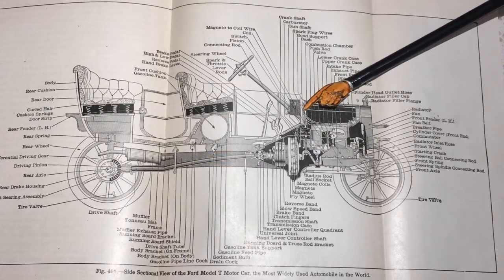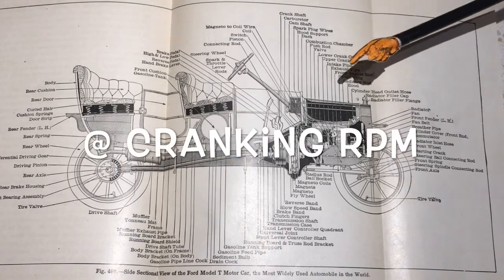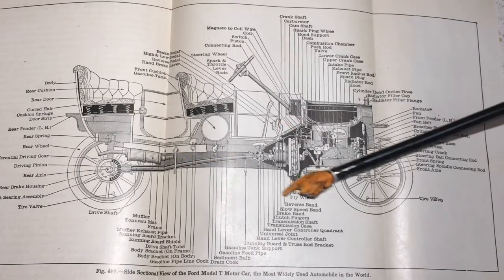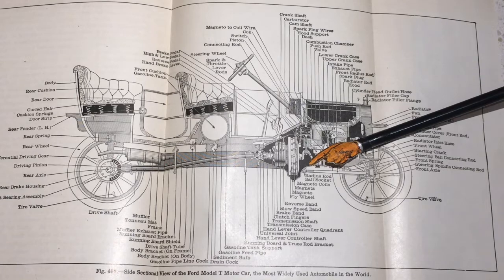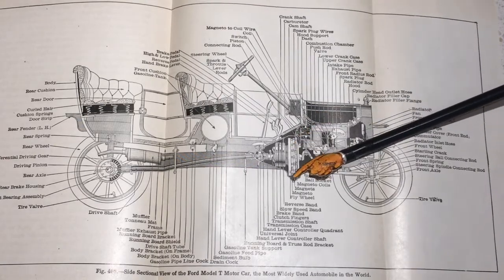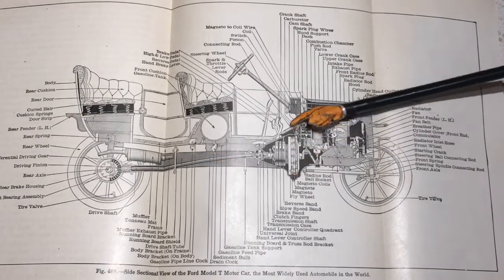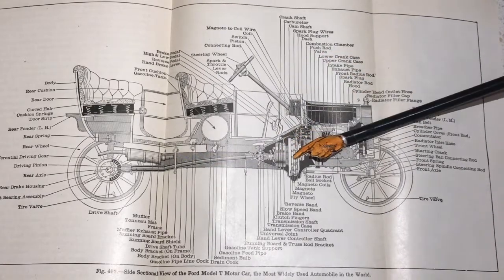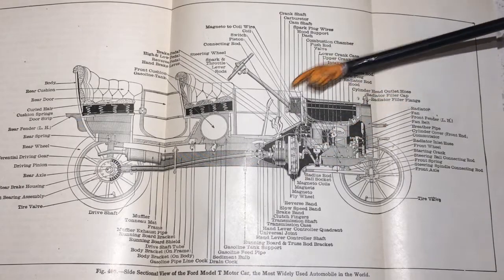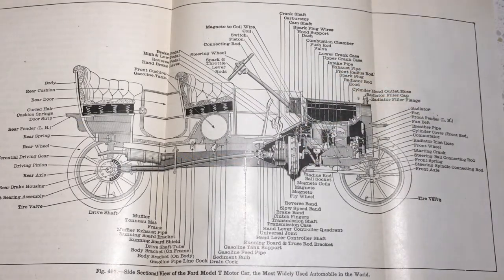There was a dry cell used for cold-weather starting because the magneto didn't put out much current. The magneto is not gear-driven or belt-driven on the engine — it's actually an integral part of the flywheel itself. There was a shroud on the backside of the engine with the coils, and I think 16 permanent magnets attached to the flywheel. As long as the flywheel was rotating — the engine running — the permanent magnets induced current into the coils. The entire system is an AC system; there's no DC unless operating in battery mode.